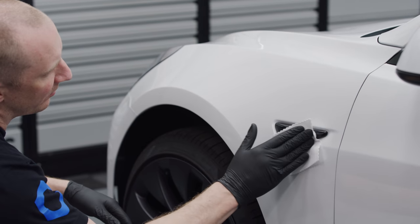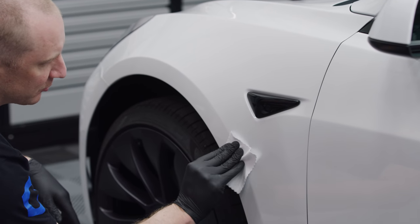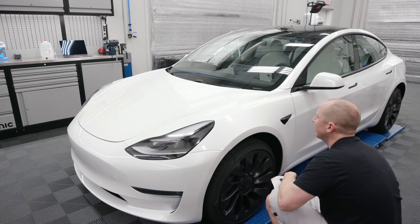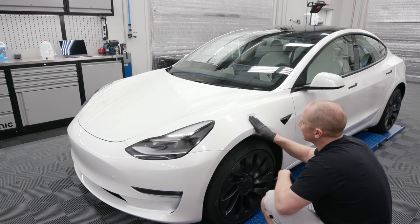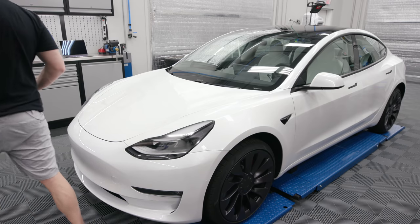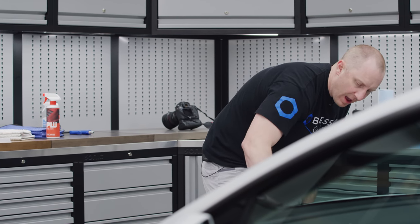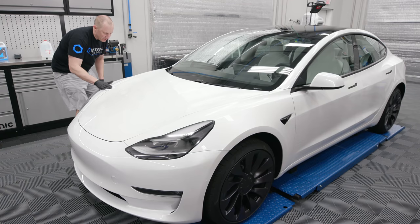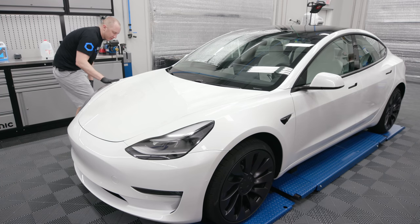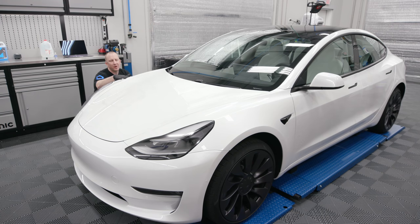Notice I'm going right over the cameras and right over the trim. I'm treating panel by panel — I'll do that whole side skirt after the fact and treat it as a separate piece. That way you stay organized: you know where you've been and where you're going. You don't want to forget areas, both application-wise and then when wiping off. Because the fender is smaller and only took a minute to apply, I'm going over to my second fender and applying here — same process.